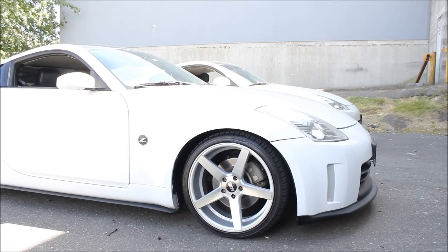What I had done on my car — if you saw the last video — I put in an oil catch can. I actually had a vacuum leak at the oil catch can that I could not hear. What I had to do was go into the live data feed and look at my fuel trims to actually see what was going on.